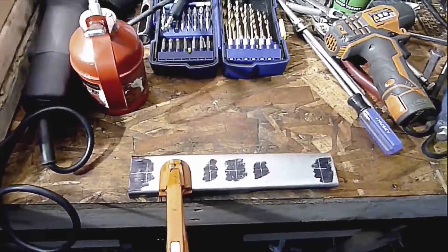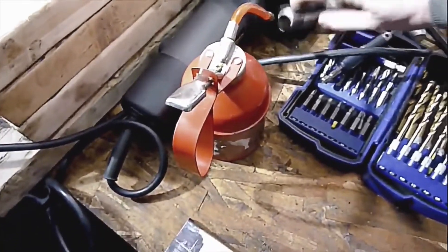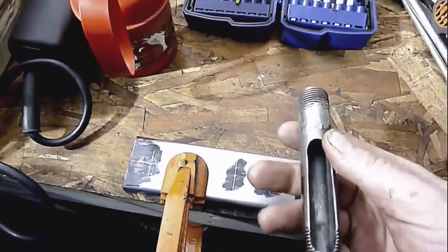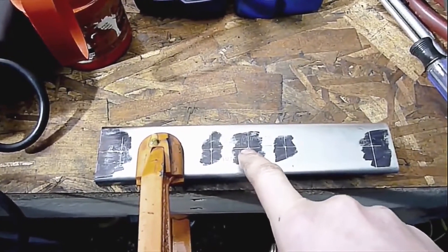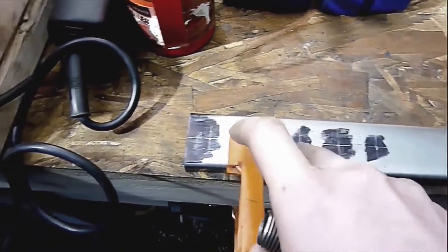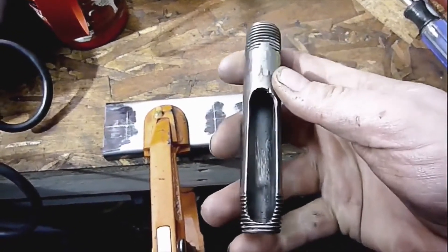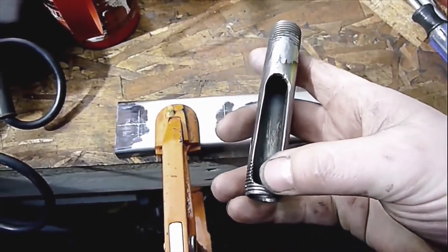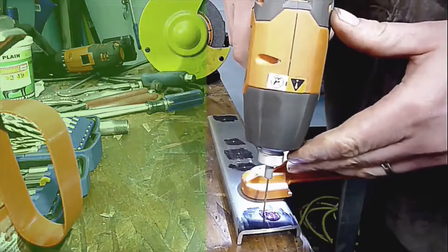Let's get into it. The first thing I did was cut the angle piece off. You can see I've got the holes marked out. This pipe with the slot is going to be the piece that pushes down on the spring and it will be welded right in the center of the bar. These two holes will get drilled and slotted, and I'll do the same on the other side. Through the two slots I'll run pieces of all-thread that will go through the head bolt holes, and there will be nuts and washers on both ends so I can clamp it down on the valve springs.